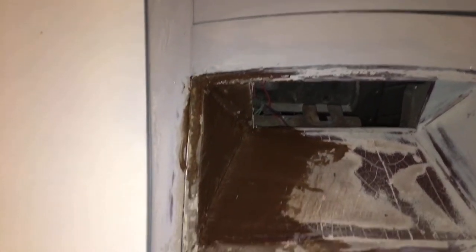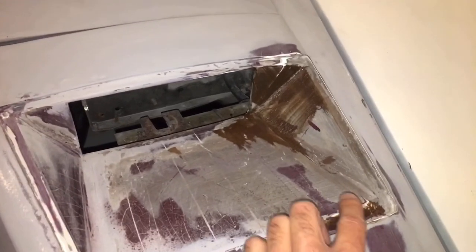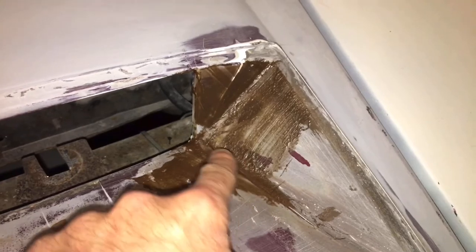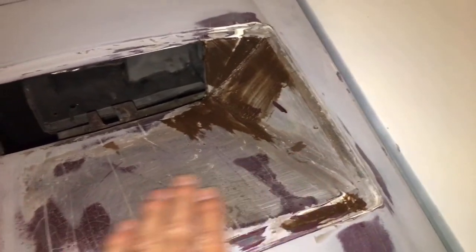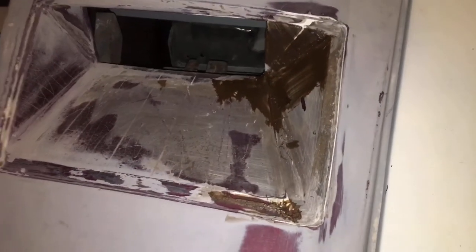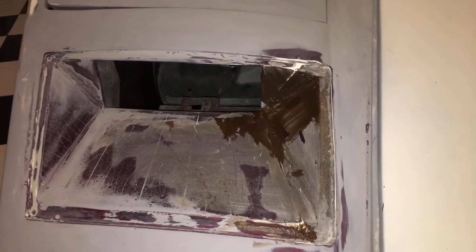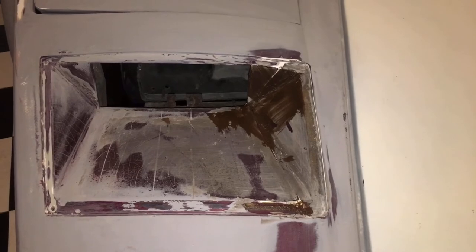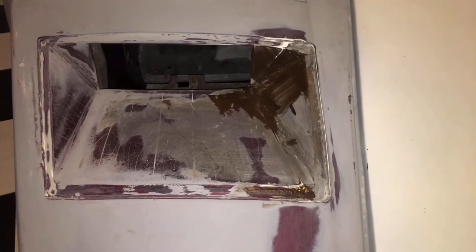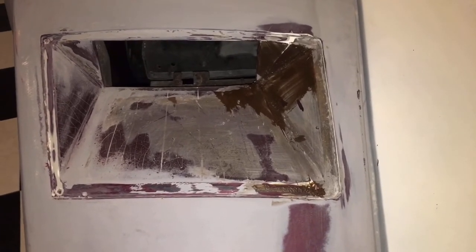Let's head over to this side. The passenger side is actually almost completely done because I've already given it all the coats and sanded them, and then we saw a little flaw back here and along that edge - right there, we're a little bit off. So I just hit them a little bit, but all the rest of this has already been sanded down nicely. Once that dries, we'll sand this as well, and then we'll be back to go ahead and hit it with the primer. That'll wrap up this video. I did want to take some time to do some work touching up some little flaws on the fenders from the work I did previously, but it doesn't look like time is going to allow that. So I'm going to go ahead and let these dry, sand them, and then we'll be back to apply the primer.